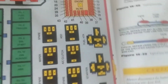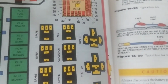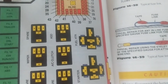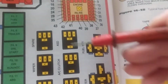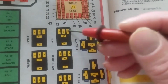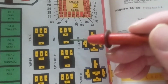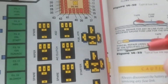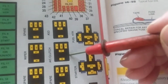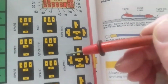Now, what I wanted to stress was, I said in the previous video on in-circuit testing, how important it is. A relay has to be tested in circuit. You cannot pull out this relay and say, I'm measuring just the terminals in the fuse box, and I have 12 volts here, I have 0, I have 12. That shows nothing to me. That is pointless and absolutely illustrates nothing to me. There is a difference between a circuit with a load and without the load, taking out the load.